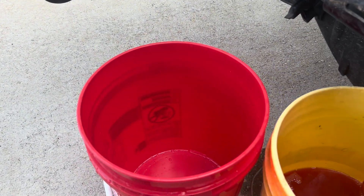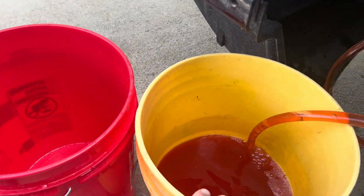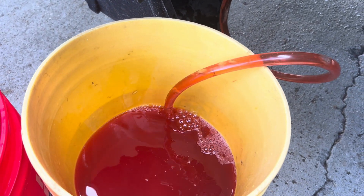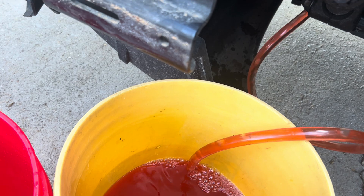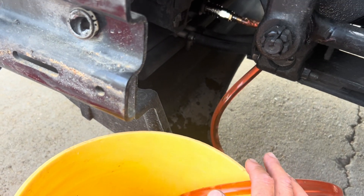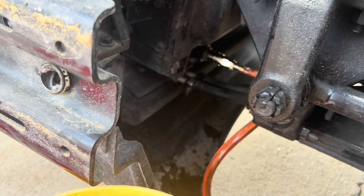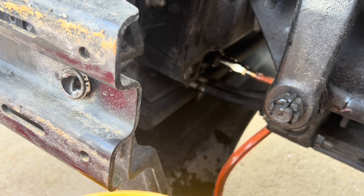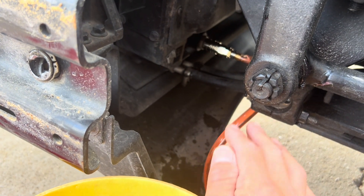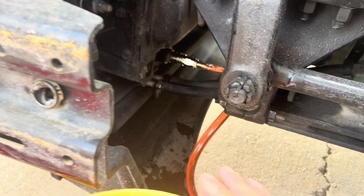I don't remember how many buckets I used last time. I've got three five-gallon buckets and then a three-gallon bucket. If that's not enough, I'll go get another. This is the way you drain it. When it's empty, it'll obviously start running antifreeze out the hose and you just unclick it. I put it in and antifreeze started coming out immediately — there's nothing to open, no petcock, no shutoff valve. The mechanism in that little coupler is what actually engages a little plunger in there to let the antifreeze out. Once you unclick that coupler — that air-chuck-looking thing — once you detach it, antifreeze stops.